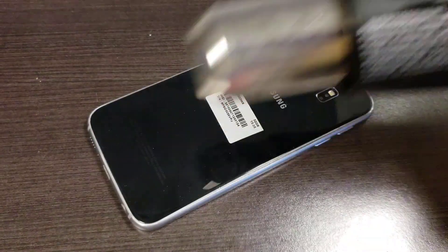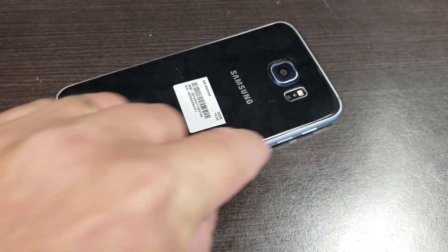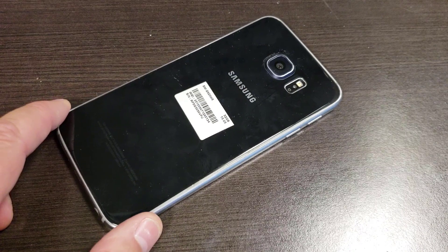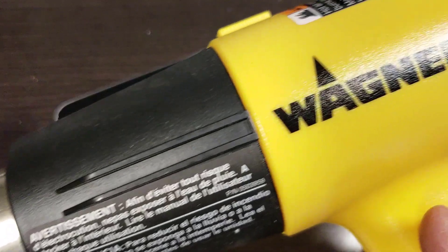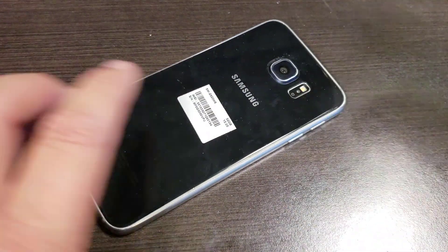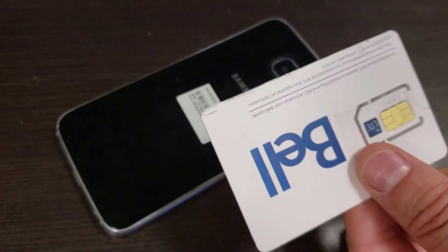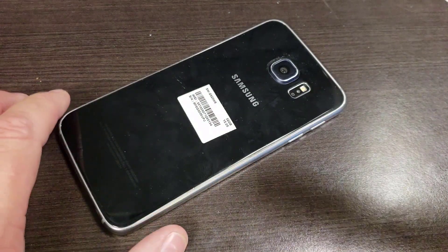You can also see here that it's gummy. There's basically a gum line around the outside that is what is sticking the glass to the back here — this adhesive. So what you want to do is loosen it up with heat, and that is what I'm going to use this Wagner heater for. Then I'm going to use a number of tools. I could use a pry tool, but in this case I'm going to try to use just a simple credit card effectively and see if we can pry it off.